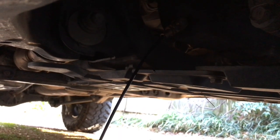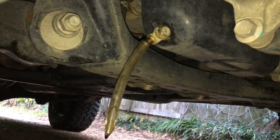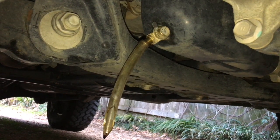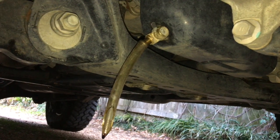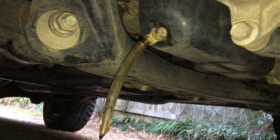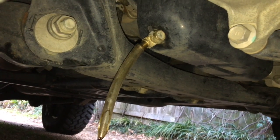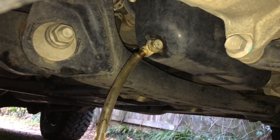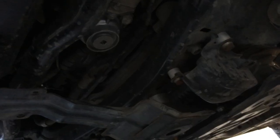So easy! Now we're going to let all of our oil drain. I've put a piece of vinyl tubing on my Fumoto oil drain valve. If you've got the stock oil drain bolt and your oil has finished draining, when you put it back in make sure you torque it to 30 foot pounds of torque — it seems like a lot but that's what the manual calls for.